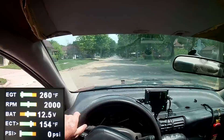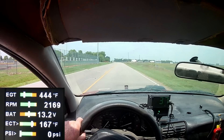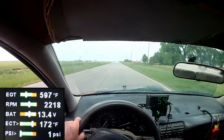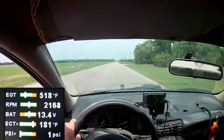We're off on our epic journey to find out if this exhaust modification is the right direction. Obviously, the exhaust stack going through the hood is a bit of an overkill, but we're testing the effects of less back pressure, and this is the simplest and cheapest way to determine what works. If we see an improvement, that means the exhaust system on this car needs to be significantly larger. In the previous episode, we experimented with a modified overdrive — swapping in a more extreme overdrive gear set to lower the engine RPM at cruising speed. The experiment showed that this little engine didn't have enough power to maintain a steady cruising speed, and we ended up consuming more fuel. So off-camera, we converted the transmission back to the standard overdrive we've been using since day one.